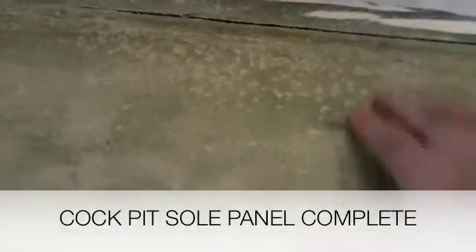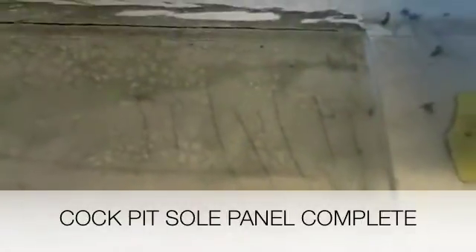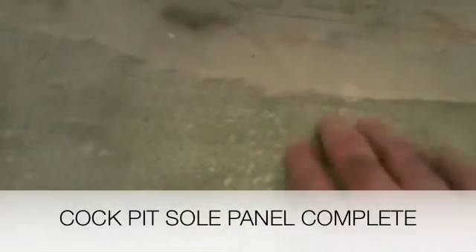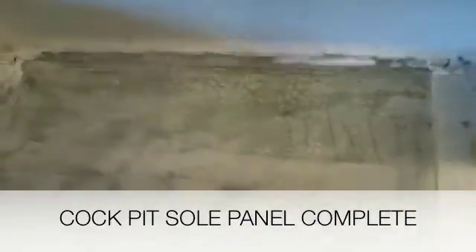When I put this together, I'll sand that flange on both sides, bond it to the original deck, and that should give a nice area to grind down and then build up my glasswork for taping it to the floor. Underneath, I'll be bonding it to the old floor, which really could be cut out completely. You can see I cut through in some spots accidentally, but it will no longer exist truly, so no water should egress into that. You can tell it's a very thin skin — almost a drum — very flexible.